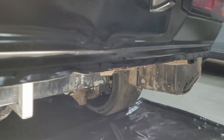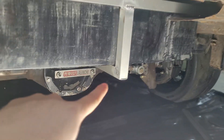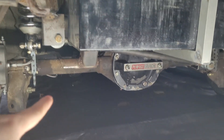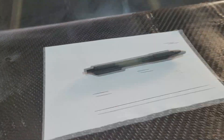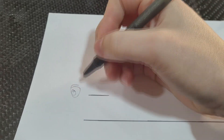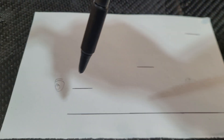Looking at this, we have three main points: the actual area that's been cut out - that's the trunk position - the back corner of the fuel cell support bracket, and the rear axle. I don't want it to interfere with the axle, it needs to clear this, and I want it to come close to this. So we're going to make a little chart - trunk here, fuel cell support here, and the axle basically right here. This is the starting point where the diffuser goes, then we mark it out, draw a smooth arc, put it on the mold, and lay carbon on it.